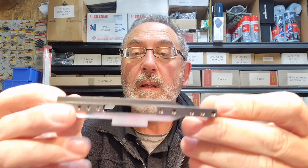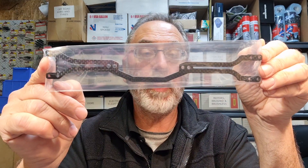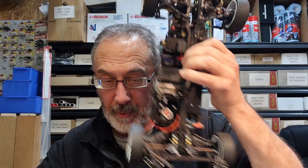The motor mount of the T3M conversion is a one-piece unit with a part here that you bolt up to hold your spur — it's solid. It uses a one-piece top deck, though you can also get half-split decks as well. The conversion can go from R3 GC, Pro — a lot of the parts on the Pro can cross over to the T3M. So there's a great plethora of adjustments and configurations you can have with this chassis.